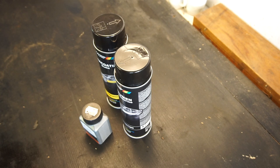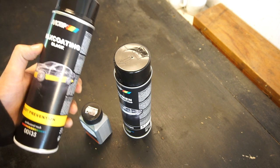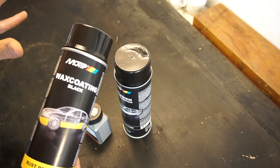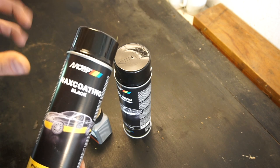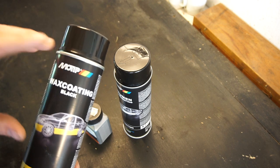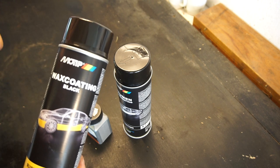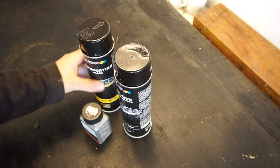Here are the products I'll be using. I'm not saying they're the best or the worst — they're just what I like to use. I think it's good to have some type of thin wax-based product first, because it works as a primer — it creeps into any areas, especially if you have old underseal where most of it is good but some areas have let go. Moisture can get in underneath, so once you clean the area, spray this in and it will creep underneath and kill off some rust while preventing new rust.